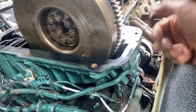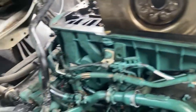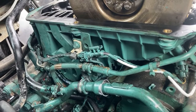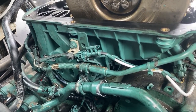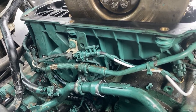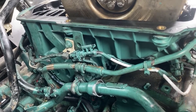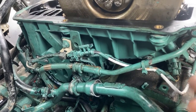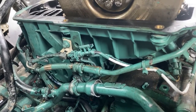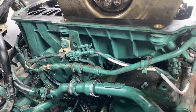you have to tighten all five bolts on that cover. Do not put too much torque — I'm not a fan of tightening as much as possible, especially since everything on this engine is plastic and rubber. Too much pressure on those covers or gaskets might damage the seal, or it will start leaking sooner than it should.